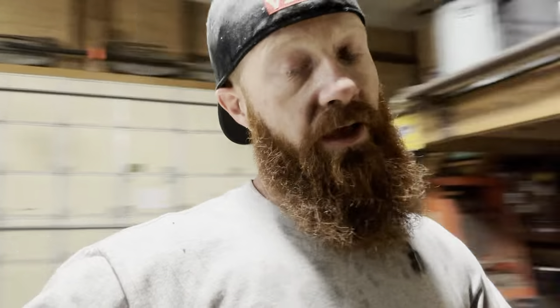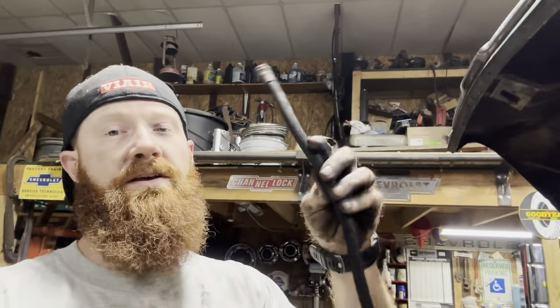After wrestling around underneath that truck for a while, I kind of kept going back - and as I suspected, it was our rubber brake hose that finally gave up on this old truck. That is what is not allowing this thing to get any fluid to any of the things. I got all of the stuff on my hands, but I just got three hoses ordered up. Looks like the front two take exactly the same hose, so hopefully they're in in a couple days and we can snag them on. I did spray some penetrating oil inside of our wheel cylinders so hopefully that'll soak in. When you heard me install those wheels, the brake shoes on this thing sound really really crunchy, so even if we get brake pressure I'm not sure if it's even going to matter - but it's worth a try.